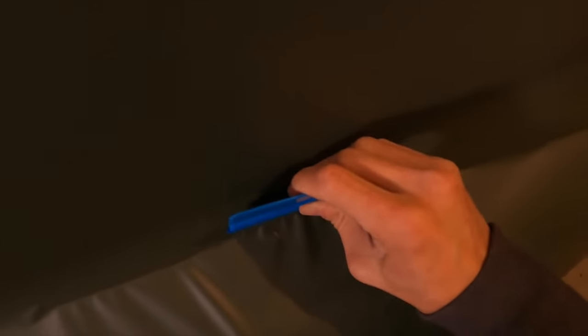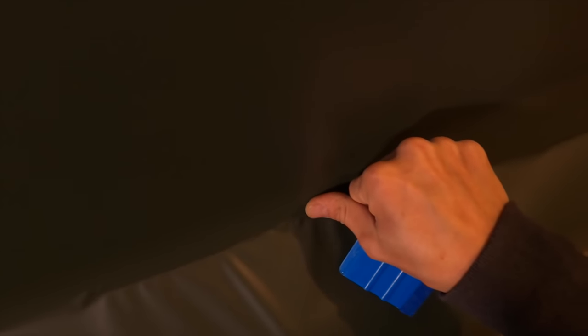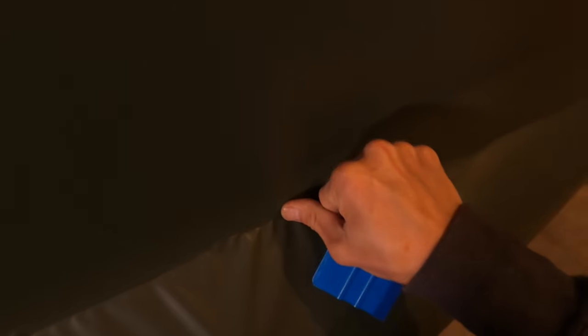Another mistake I made was overstretching the vinyl. Now, the recommendation is that the vinyl should stretch between 10 to 20%, but there were some points where I tried to get it to a certain point and I believe I stretched it a little bit too much. So that is definitely something I'm keeping in mind for the future, as well as keeping the settings around me at room temperature, because that did affect the ability for the vinyl to stay intact even when stretching.